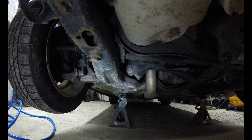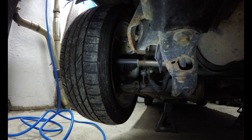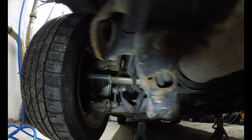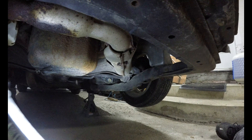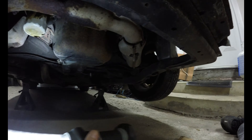It does all look like bearing material, but it's not crazy excessive, so that's a good sign. Obviously something has really let go and it's likely a rod bearing from what I think. Looking at the bottom of this thing, it's really dry and relatively rust free — the subframe looks good, even the control arms are in pretty good shape. Looks like it had a tie rod done, and the coil-over suspension will be coming out of it.